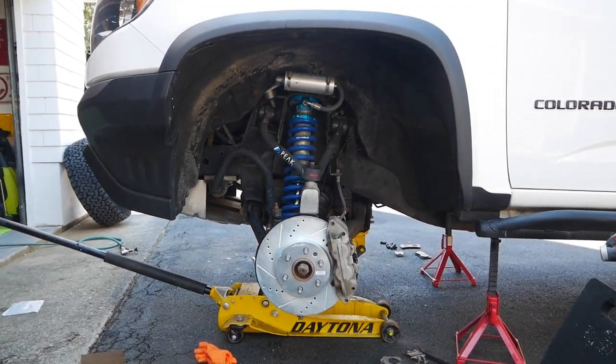The weak point is on your actual tie rods, because those will be the point of failure — which is actually the point you want to fail so you don't destroy your steering rack. But with these long sleeves, you're strengthening the tie rod too much and the next weakest point becomes your steering rack. The new design has a short version, about three inches. I instantly regret that decision — driver's side is done, passenger side I can't get off. At least that side's okay.